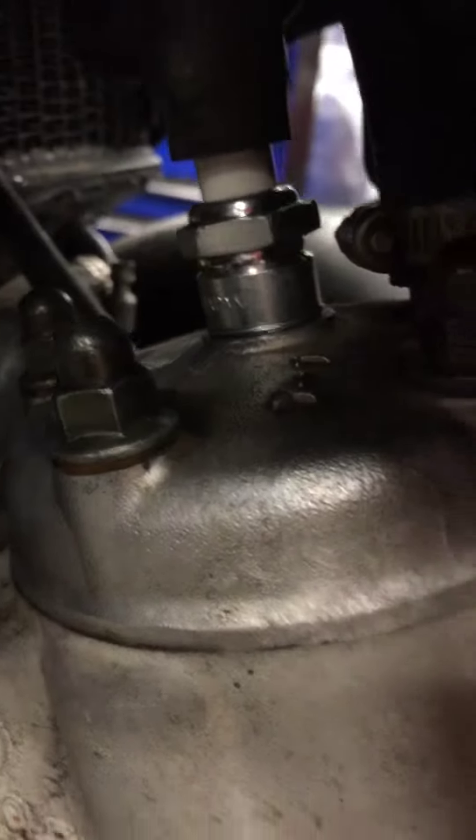I just went ahead and tried starting it. It was super loaded up with oil in the exhaust. When I pulled the plug, the gap was super gnarly — way too far gapped out. So I closed it up and reset the gap. I also checked compression, all the way up to around 150, so plenty of compression on this bike.